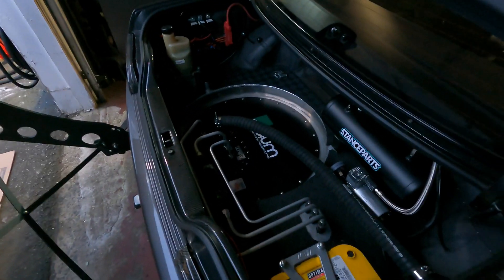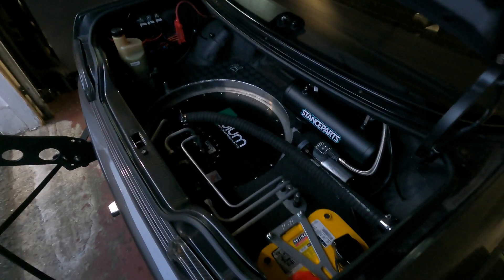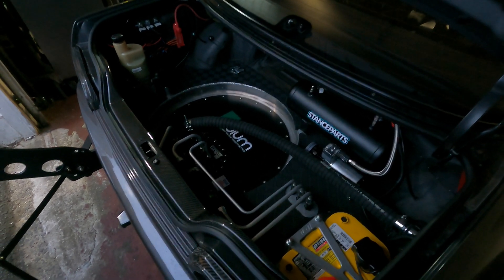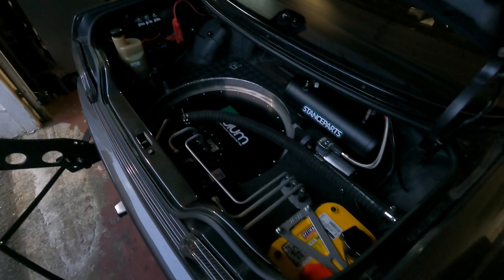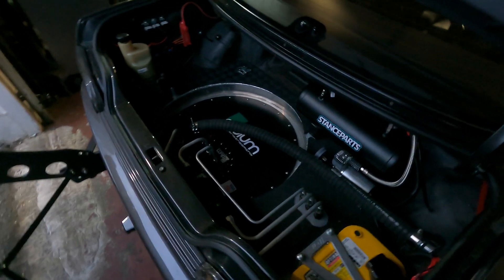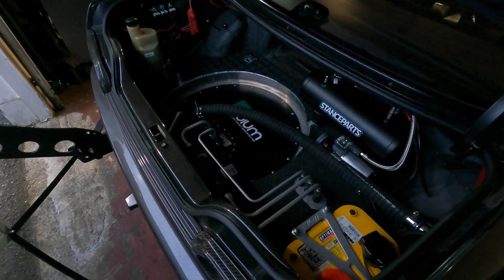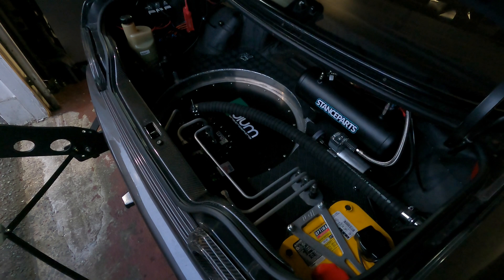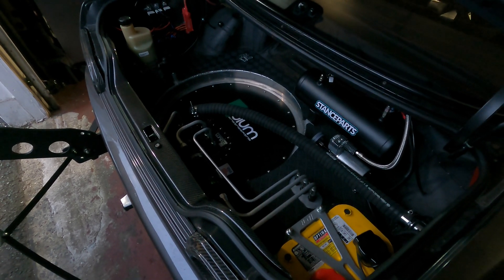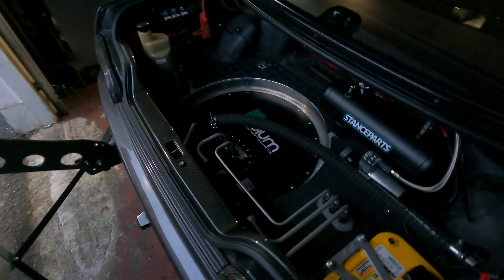Here's the trunk. What I've done here is actually replaced the floor in the trunk with an aluminum floor, which has been custom fabricated by a good friend of mine who does fab work. I had him build this to spec — I created a template first out of cardboard and then out of Alumilite, marking how everything was going to go, making sure I could take this thing in and out of the car, and figuring out a way to fasten it in properly and safely.